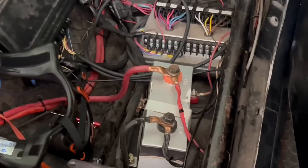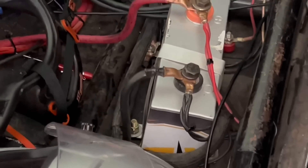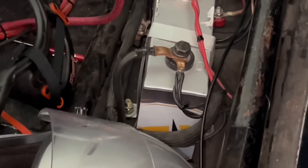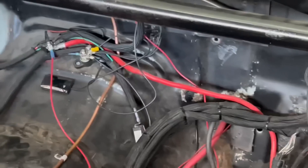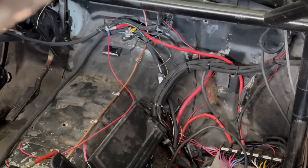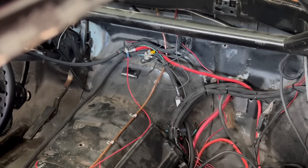So what we've done here — see on this negative battery post, we've got the big cable and then all this little group of cables. The big cable goes up and grounds directly to the engine, to the back of the cylinder head — straight from the battery to the engine. Several of these other wires are just for grounds. They go up to a ground block. Those grounds run things like my ignition panel from Junior Bissett. Lights are grounded through there, anything not related to the Holley — like your body grounds, my water pump, all that good stuff.